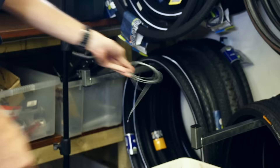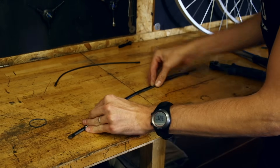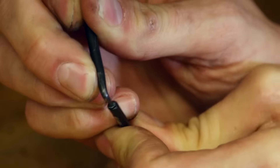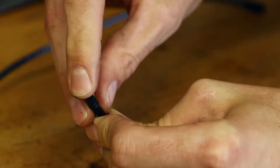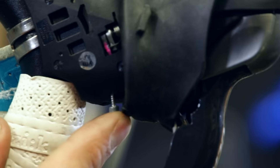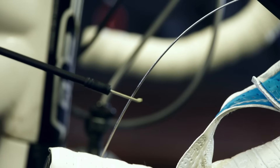Now's a good time to cut your new outer cables down to the right size. This is the point where those extra tools will come in handy. Use the file to get rid of any sharp edges, and use your pick to make sure that the inner cable will thread nicely through. Now put any of the ferrules on that are needed for your bike, as they were on your previous cables. Take your new inner cable and thread it through the shifter, putting it snugly into place. Thread the first, longer piece of outer cable on, and lodge it into the correct place of the shifter.